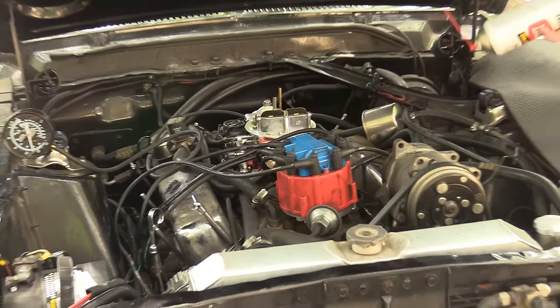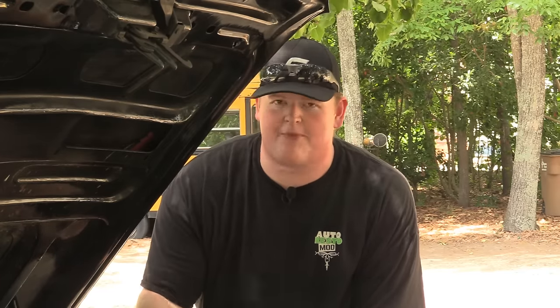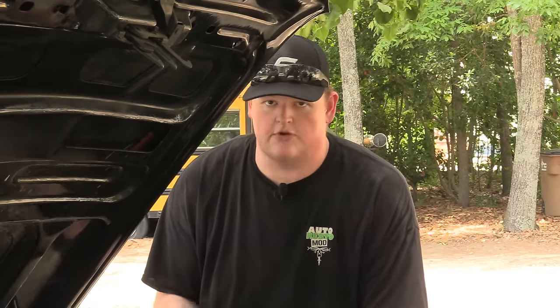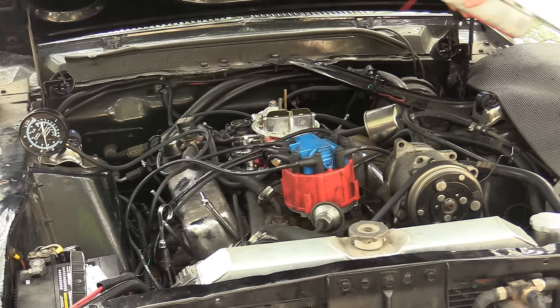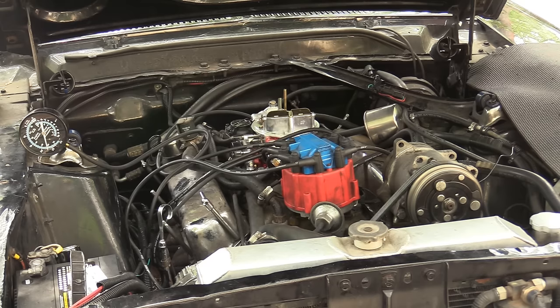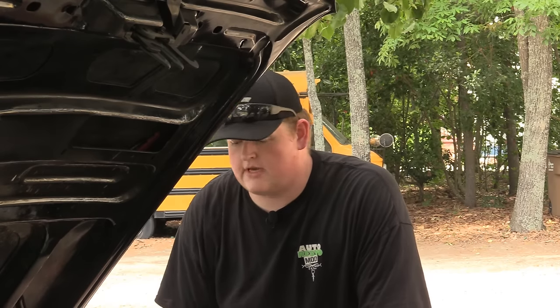I'm going to show you how to find a vacuum leak if you think your engine has one. We're at 23 inches of vacuum at idle, so we don't believe this one has a leak. If you have high RPM you can't control at idle, that's typically a vacuum leak. To find intake leaks, you can use carb cleaner — spray the intake surfaces where the gaskets meet. If the RPM changes when you spray a gasket, the engine sucked it in through a leak. You can also put your hands over the primaries on a four-barrel — the vacuum gauge will shoot up and stall the engine, meaning all the air is coming through the carburetor, not around the gaskets.